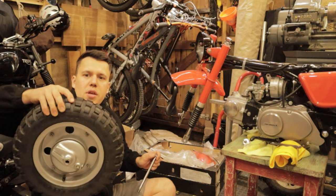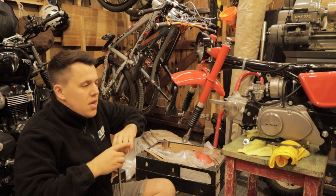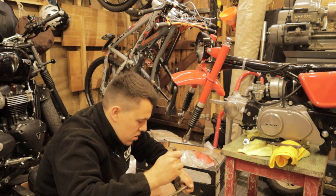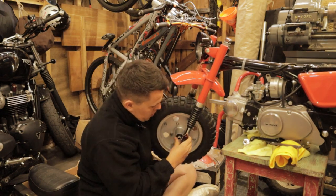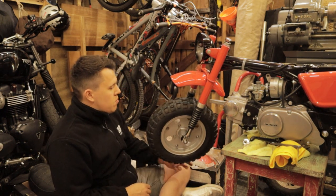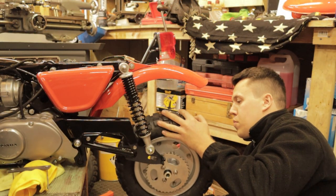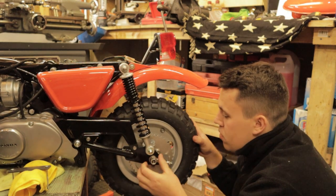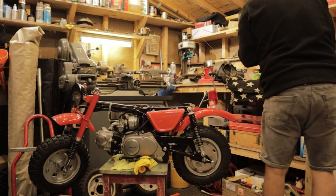Wheel fully sorted. I'm going to grease up the bolt and try and get it into place — just waiting for the top yoke lacquer to dry and then we can start building up from there. She spins! Bit of brake noise but that will go as the drum beds in. Following the front wheel we head to the back and stick the freshly finished rear wheel on — very similar procedure but much easier. There's no pivoting forks, literally just a through bolt, spacers, and some chain adjusters. Give it a spin and it's spinning nice and straight. And another cool big moment is getting the tank on the bike. This really brings home how long it's taken because this tank has been off for so long — great to get it back on and looking more like a monkey bike. Both wheels on, tank is on — it is actually starting to look like a monkey bike.